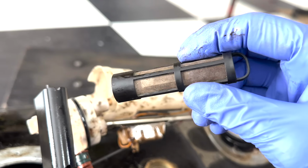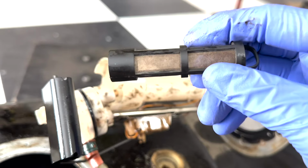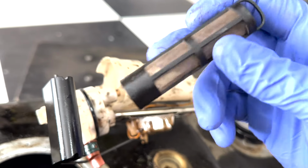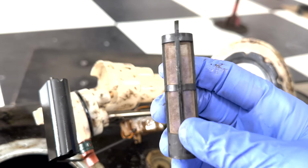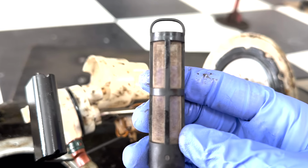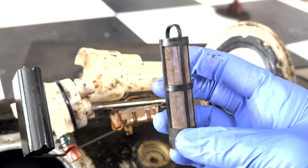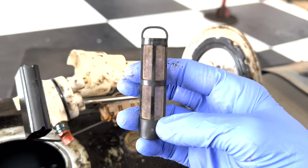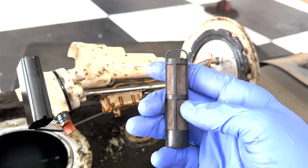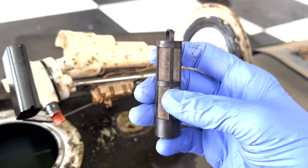I remember back, I would say 18, 19, 20 years ago, I got burned on an Econoline that wound up being this. And the code P1211 was the dead giveaway that I just did not know. I was not familiar with why we were setting a 1211, ICP too low, too high than desired.